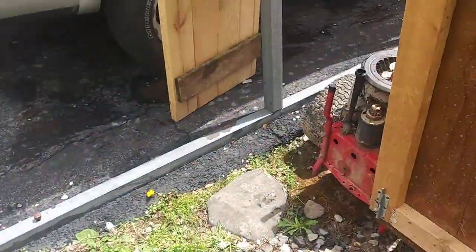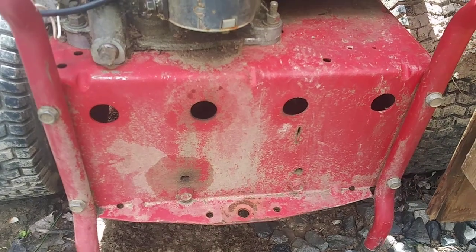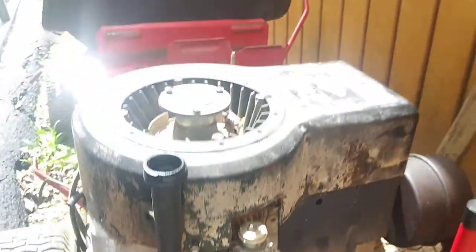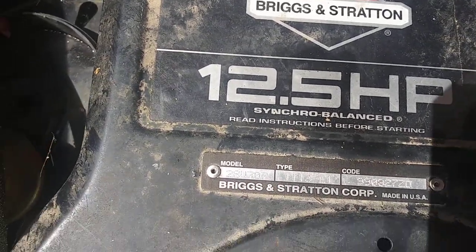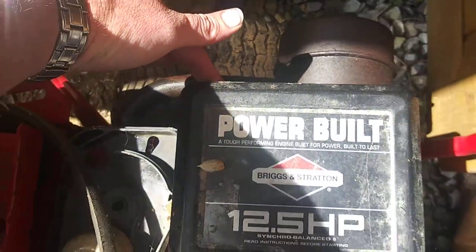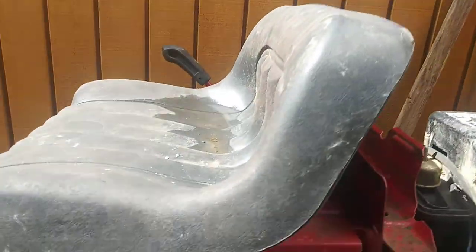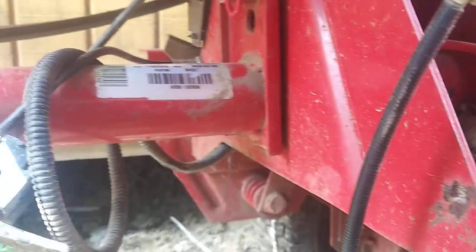Out here to the more modern Snapper — this is the scrapyard Snapper that was for parts, it's been through a flood. Now some of these Snappers will have a little white tag on this back plate here with the model number on them. Series 23 does — this is a Series 21. The model number for the engine is slightly different on this unit; it's stamped on top of the blower housing. For ones that are older than this, they will be stamped on the back edge of the blower housing. The model number of the mower is on the tube that goes from the back to the front — that's your sticker right there.